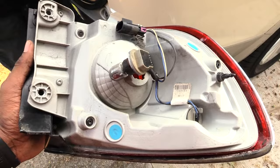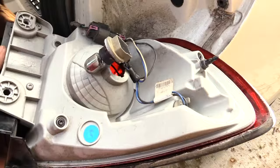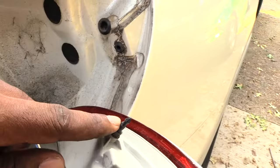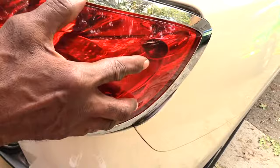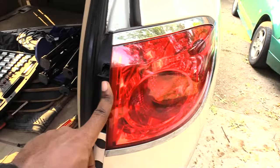When you're coming back in, put your new brake light in. If you changed the whole assembly, just plug it back up and put everything back together. See that little hole right here — you put it back on and make sure this little piece just slides into that hole. Push it back up onto the vehicle, line it up, push it back up, then come back around and put your two screws back in. Pretty much you're good.